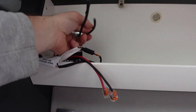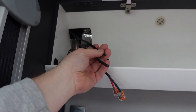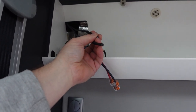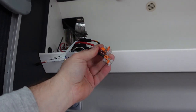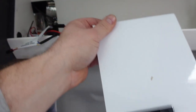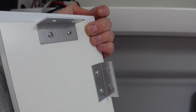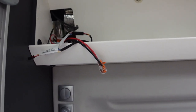I've decided to put in two new cables - two proper solar panel cables. These are UV-rated cables so they don't break down from UV light on the roof, and they're also 4mm which is powerful enough for what I've got on the roof. I took this panel down here - the heater control panel - which is only held on by two brackets and four screws, making it easier to do the job without damaging anything.